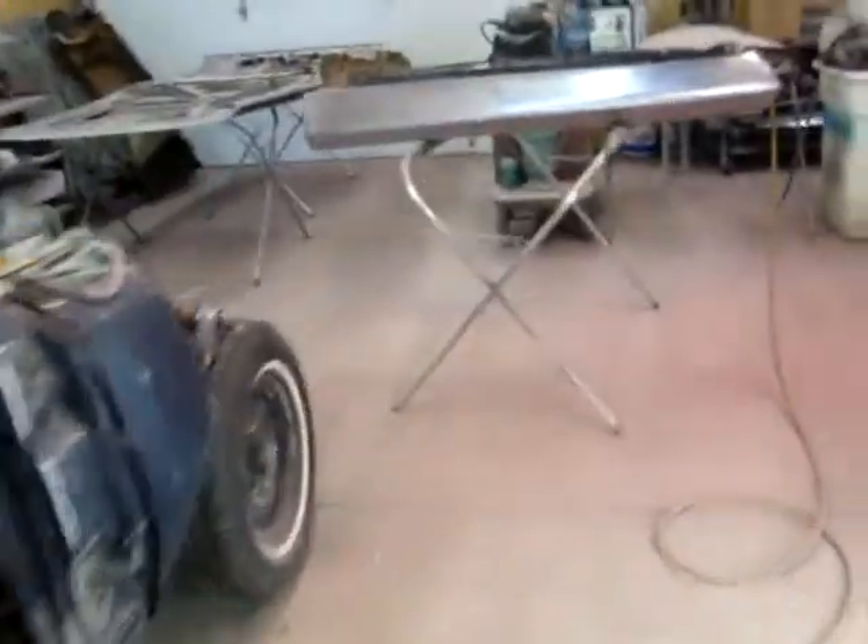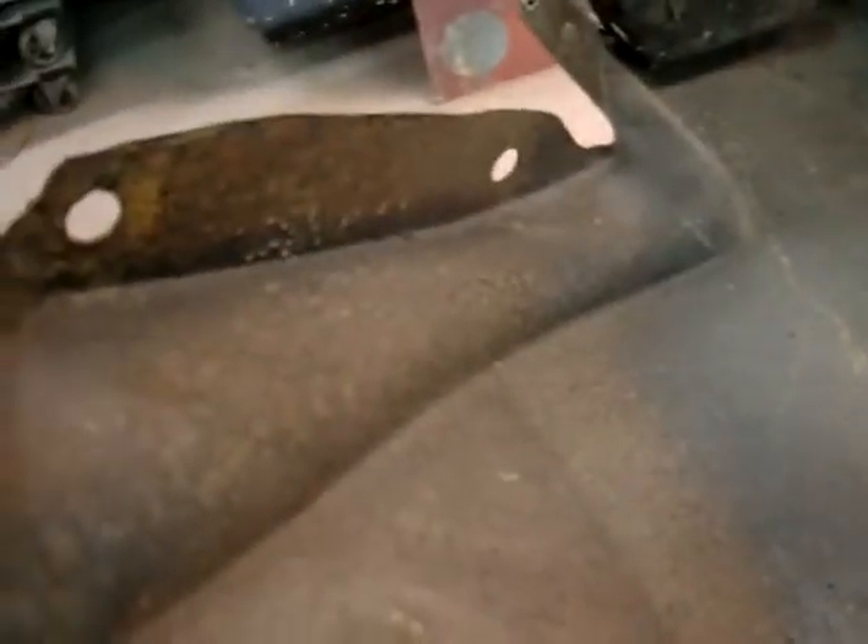Another little look at this fender - some of the things folks just don't get: where you're supposed to stop. You can see this inside was poorly done - there's rust down here, it's just surface stuff and you won't really see it once the car's back together. Where do you stop as a shop owner? What's quality work? And then someone used some kind of paint up here - see what it did? It all wrinkled up. I can't paint over top of that. This is all supposed to be body color. I think this fender is originally white - this is some of the original white coming through all the way back through here and all this contour area. You can imagine how long it's going to take me to clean that up enough that I can paint over it.